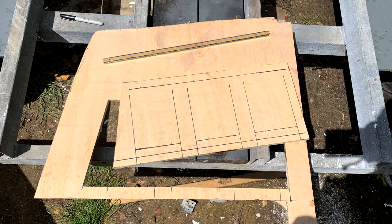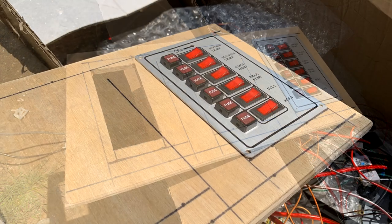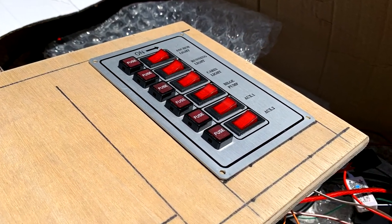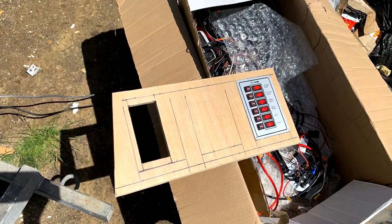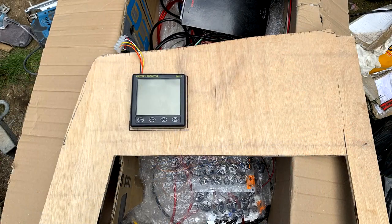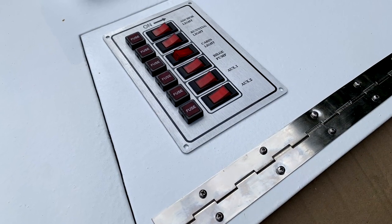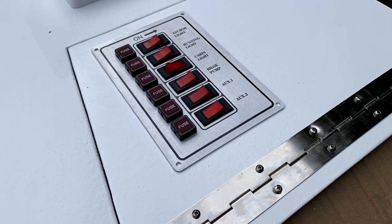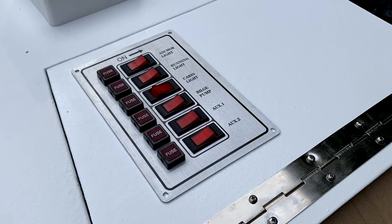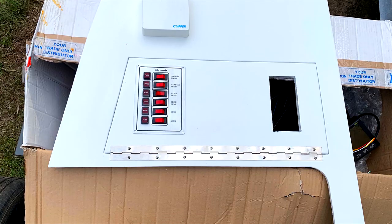When making this fold-down door, to get the cut right — because I wanted to keep the door as it would be exactly the right shape — the thickness of a jigsaw blade is perfect, like the reveal that you want. So getting the same diameter drill bit and drilling holes down onto my cut line, I could then start with the jigsaw and cut that out perfectly. Then I could just add the hinges and cut the holes the same way for the switchboard, although the wood behind the switchboard would be removed. All it needed then was paint and attaching the hinges, and you could see how well it came out.